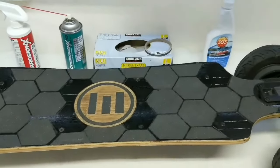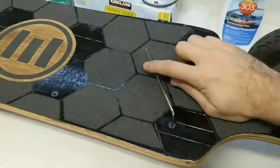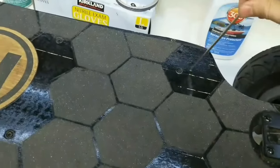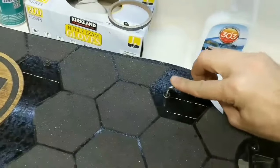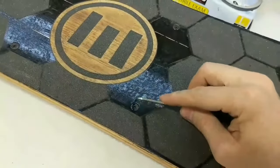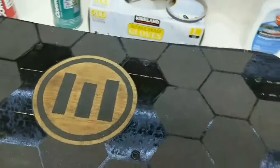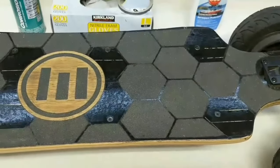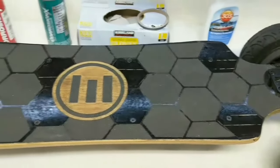Since it's a very carvy board with a lot of flex, the screws can loosen over time. I'd suggest retightening them every once in a while to keep water resistance at its max. But don't over-tighten — that will break the seals and you'll lose water resistance. Make it fairly tight, ride it, then retighten a little more and keep an eye on it as regular maintenance.